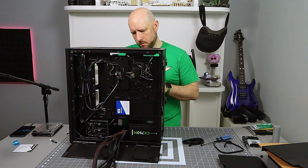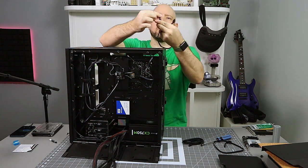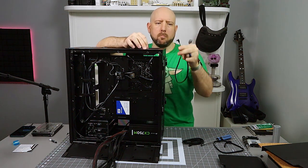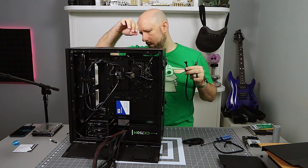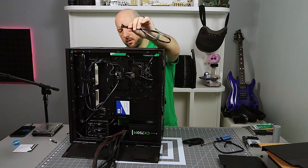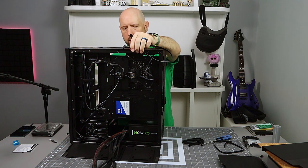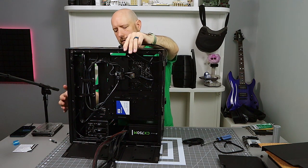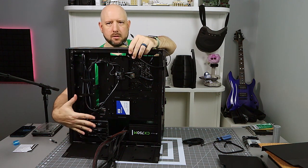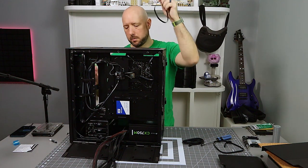These guys have to go. Most SATA cables, not all, but most have one 90 degree bend and then one straight side. It seems logical that the bend would go at the motherboard because it's making a 90 degree turn to go out behind the shroud. But these hot swap connectors are all pressed up against the side of the cage. So you really need to save the 90 degree bend for the back of the hot swap cage.